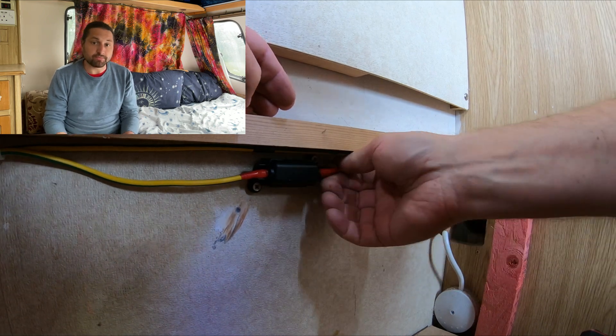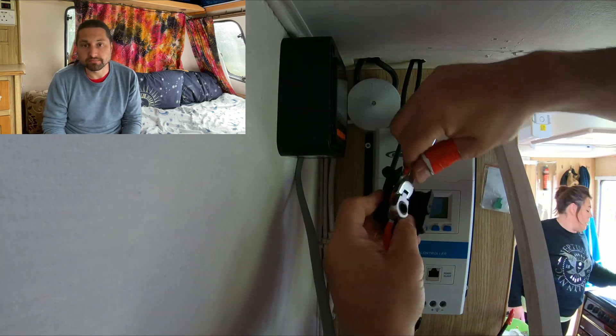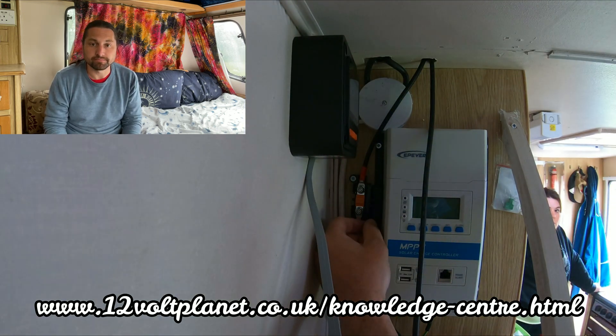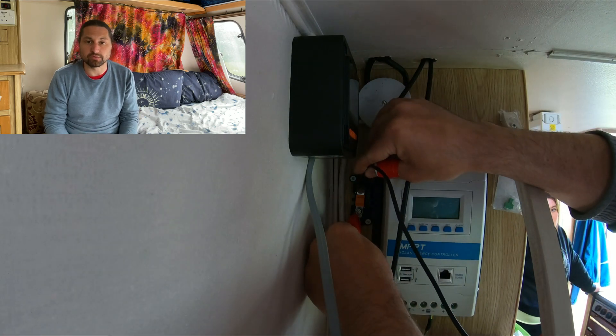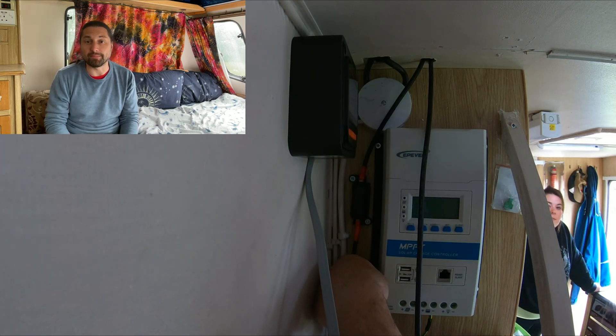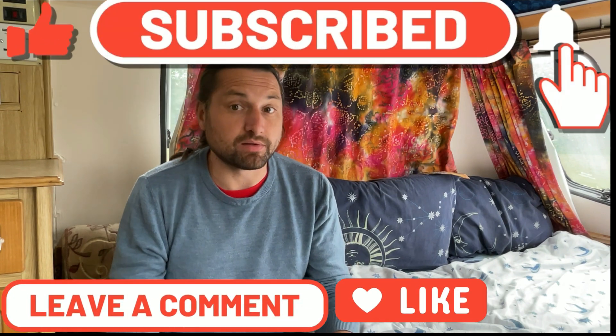For these two I have installed 30 amp fuses, but I have also ordered a mega 200 amp fuse to go between the inverter and the battery, though this has not yet arrived. For more information on fuse selection take a look at 12 Volt Planet, which is an excellent resource for this type of work. In all I am quite pleased with how the install has gone and look forward to saving money on site fees as well as being able to run computers and printers whilst on 12 volt power. This is my first step into solar PV and I imagine that there is a lot more to learn about batteries and other things. However I will run with the setup I have for a while first before deciding whether or not to upgrade the leisure battery. Feel free to ask any questions in the comments below — being a small channel I am still able to reply to all of your comments. If you've enjoyed the video please give us a like, and if you want to see more from us then consider hitting subscribe. Until next time, cheerio from us.